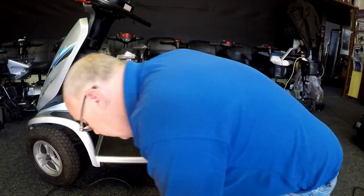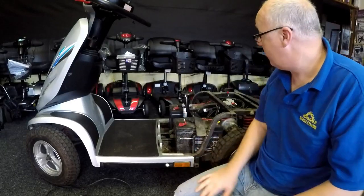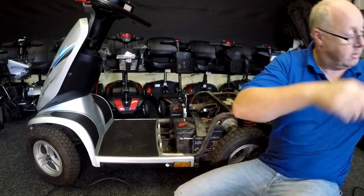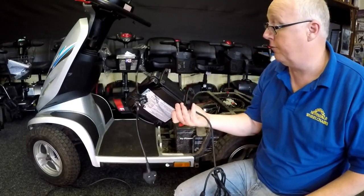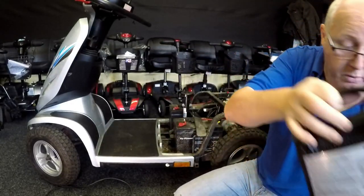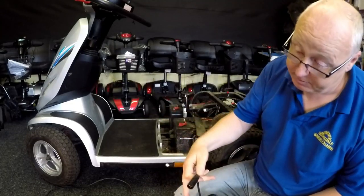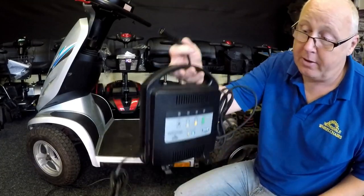£140 is a lot of money for a charger. I would recommend for this size of batteries — anything above 50 amp-hour — to get an 8-amp microprocessor charger. Very good chargers these. Some people have seen me selling for £140 — we sell it for under £100. So if you use this charger, we need to use the three-pin connector now. It's a cheaper charger — the customer saved £50. And if it fails in the future they just buy another one of these.